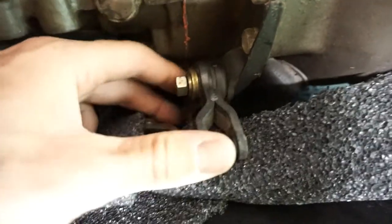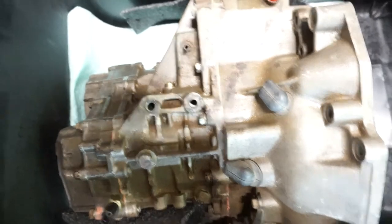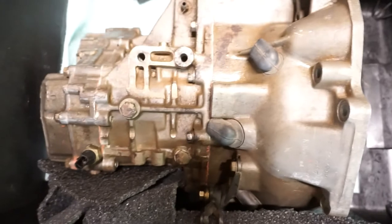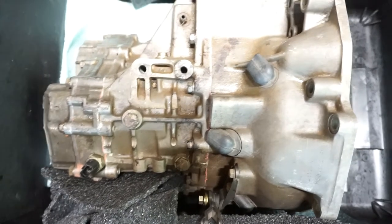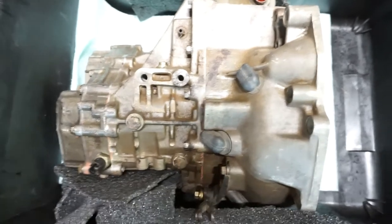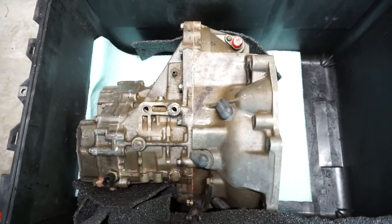Extra breathers, and dual shear shift linkage instead of single shear — so it's a lot more robust. The case is magnesium. These are helically cut gears but the gear angle is a little more shallow for strength than the standard gearbox, so it's a little louder. The gears are wider. It's still a five-speed dog box. The input shaft is the same diameter and spline type as an Evo 8 — so a lot thicker and more robust. The case is quite thick too. These are super rare — the factory used the Hollinger, but if you were a high-paying customer that wanted a factory built car, or if you had a Galant VR4 in the late 80s, this is probably what you'd get. There's one of these in the car now and this is a freshly rebuilt spare. Thanks for watching — if you have any questions, throw them in the comments.